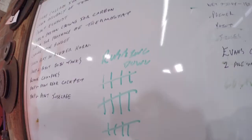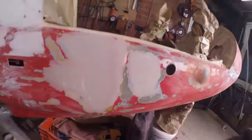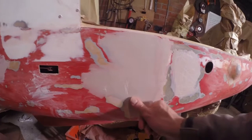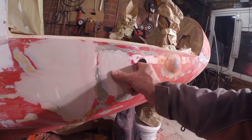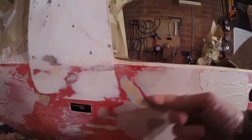Rubbing down for over a month of evenings - this is a labour of love. So this is night three on the starboard side. We've flattened out those dips a bit, they're not looking so bad. Flattened off the top of the monocoque there where the wood is. I need some masking dead on the back here and there's some masking to do underneath just to protect these areas. I've got to build this up a bit more - there are a couple of low spots there where my filler didn't really go in enough. This has still got - I want to run a straight edge across it - still concave, just trying to get it to flow. And then it bulges back out there. I'm hoping this body filler is going to be flexible enough - it's not a massive thickness, probably less than a millimetre thick - but it's just a case of trying to get it to fade in and blend it all in.